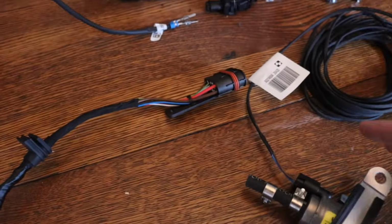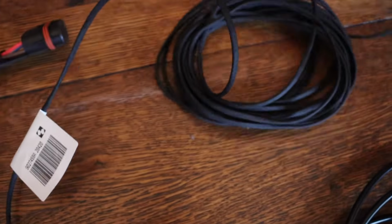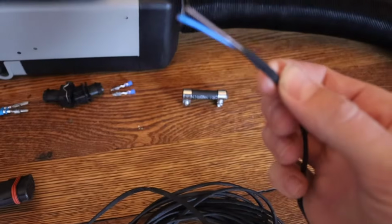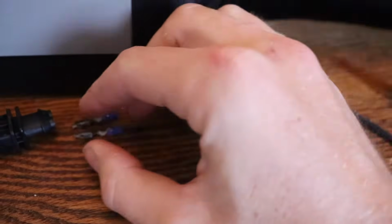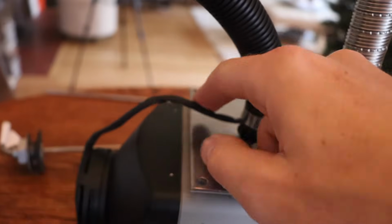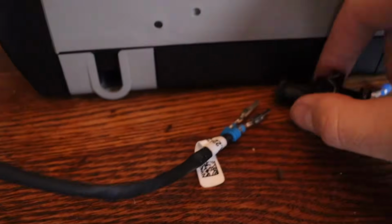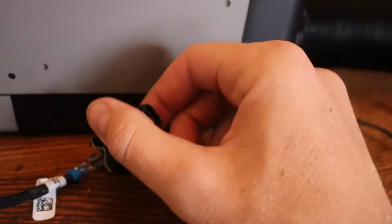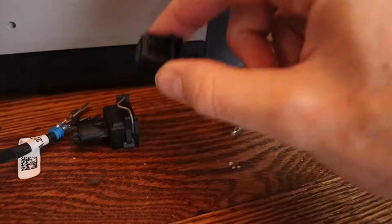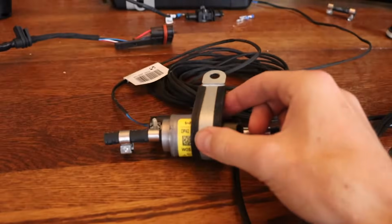Now to power the fuel pump, there is a clip on the front here that these blue and green wires can plug into, and then they just give you 2 bare ends of the electrical part here. So what you do with the fuel pump is you strip these 2 wires, you feed it through these clips. Those go into these little slots that you can barely see through the middle. This part comes out of the heater itself. It's already connected, and that goes through this part right here. And when those are secured in there and these ones are secured into here, you can then connect them, and that's what connects those lines together, powering your fuel pump.